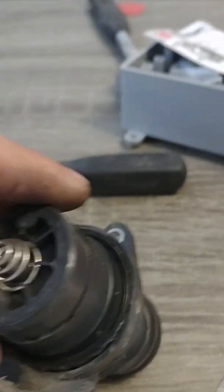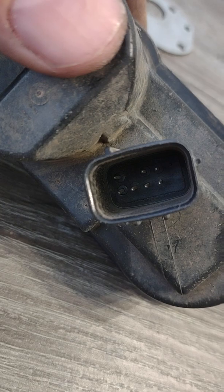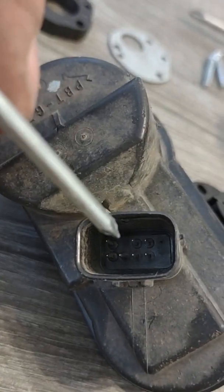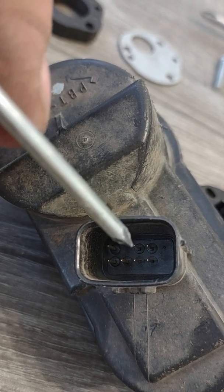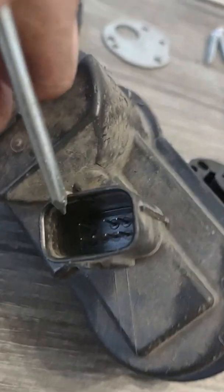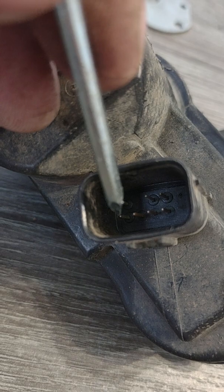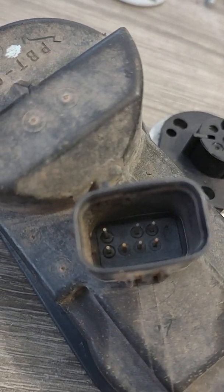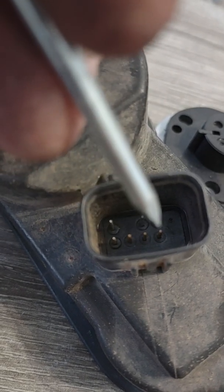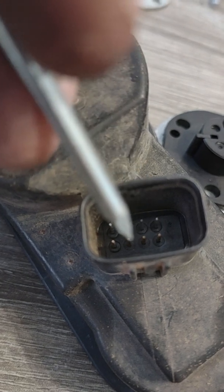There's a couple things inside here. One is this plunger valve which you can actually test. There are a couple of things you're going to notice. This one and this one here — these two pins test the solenoid. This guy right here. It doesn't matter positive or negative. Now this one here is the negative for the vacuum motor and this is the positive. There's a sensor board inside and if you touch these or short it you will have to go buy yourself a new one, so do not touch these at all.